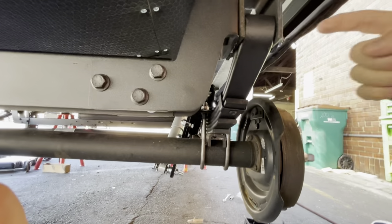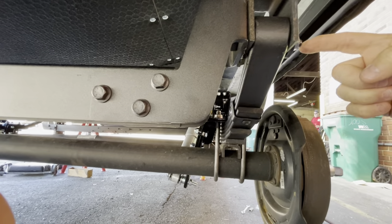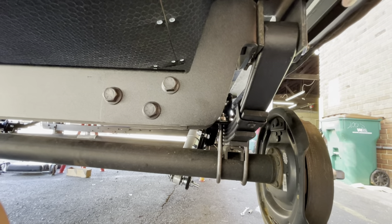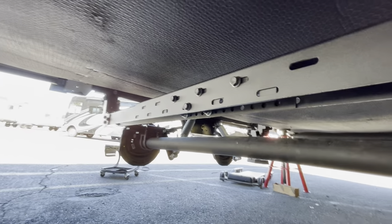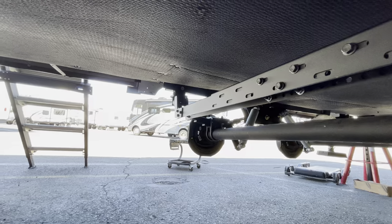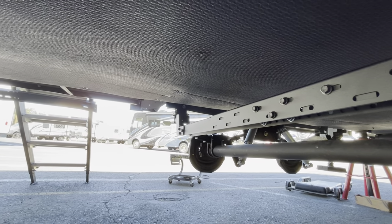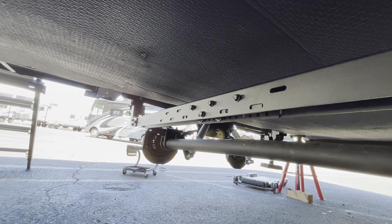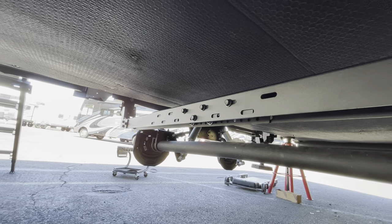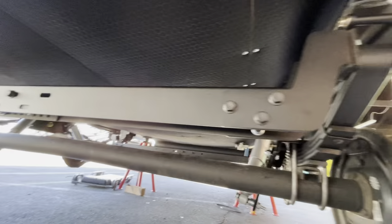When this goes in, you're basically pulling the bolt from the spring hanger and replacing that, and this gets sandwiched on both ends. You have three bolts on either side, another eight bolts in the center, then another six bolts, and then another two bolts. So when installing these you basically have 9, 18, and then another eight — quite a few bolts to put in. Make sure you're torquing them down to the right specs per the manual.